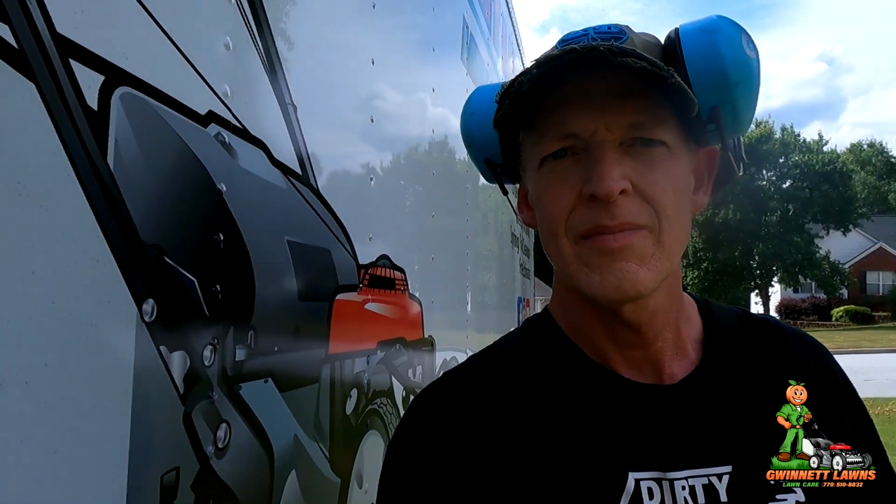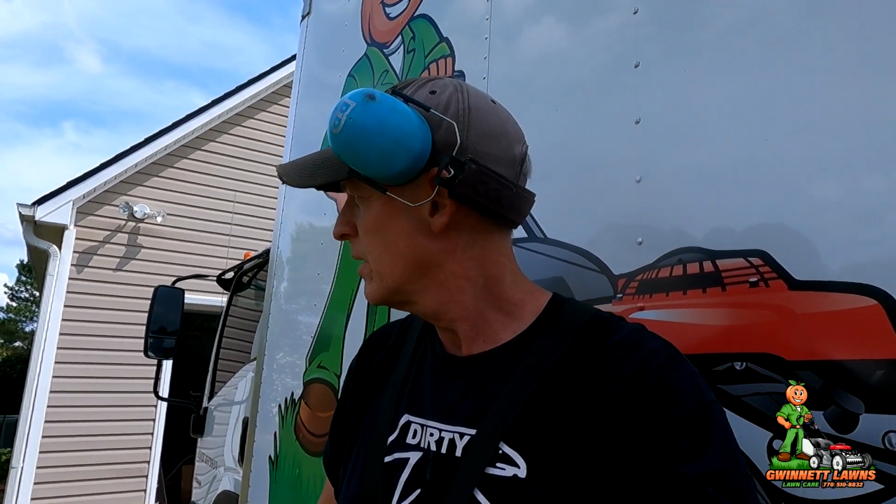That is a success. So what was the main problem? I have no idea. Maybe there was some junk in the carburetor. Also, the fuel that's in here right now is the 93 octane TruFuel. I did try different fuels just to see if that could possibly be something that this blower is temperamental with, and it's not, it had no difference at all. So anyway, the carburetor definitely solved the problem.